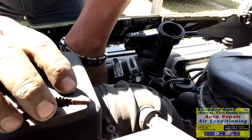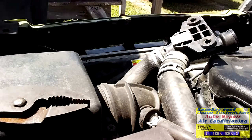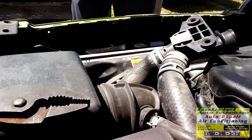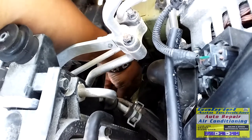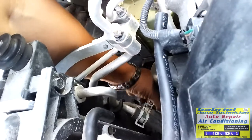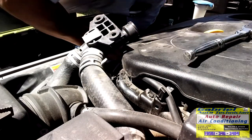There's no coolant in it because it got a leak and the previous owner replaced these hoses, so they put water in it. Let's remove the bottom hose - the lower radiator hose. Somebody replaced this hose already so they put a different kind of clamp, but it uses the pressed clamps. This one has water already so we'll do a flush to clean it out.